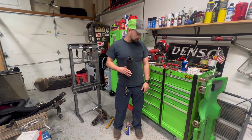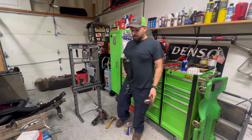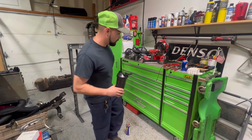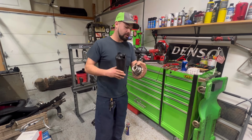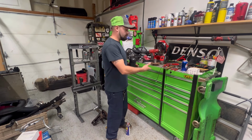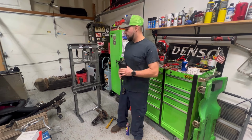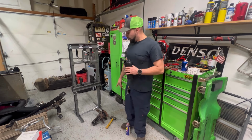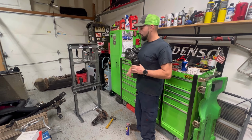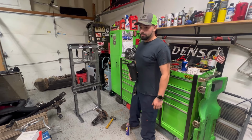We're gonna get cracking. Basically where we left off was we got the hub out of the wheel bearing, and we got the original wheel bearing out of the knuckle, and we still have part of the bearing stuck on the hub. So we're gonna put a slit in that with a cutoff wheel, try not to damage the hub itself, and use the air hammer to knock that off. I don't have a puller or bearing separator right now that would take that off, but the air hammer will work just as good. And now that we got that new air compressor, we'll be able to use the air hammer. So once we got that off, we'll clean up the knuckle itself with a wire brush, clean it up nice and good. We'll get the bearing pressed in, we'll get the hub pressed back in, and we'll get that knuckle back onto the car, and then it should be golden. So we got plenty of time, so let's get cracking.